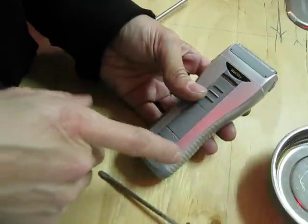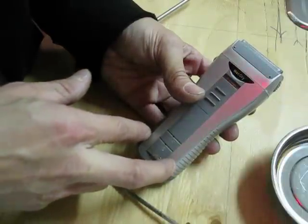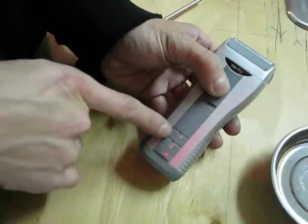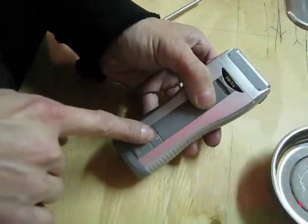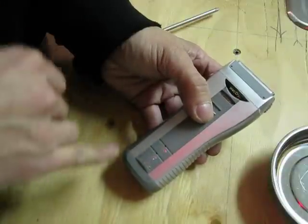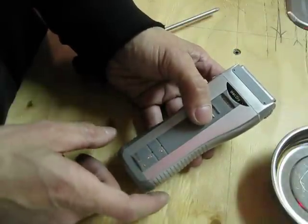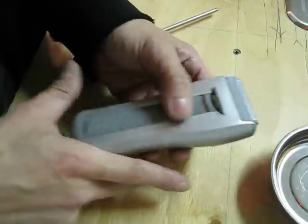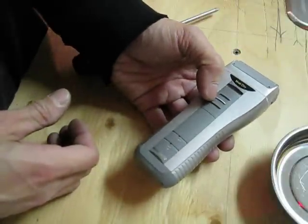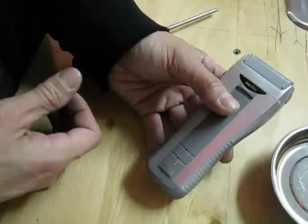The difference between using nickel metal hydride batteries versus NiCd batteries is that nickel metal hydride when fully charged — the voltage isn't as high as a NiCd, if I remember right. Now when I use this, the recharge light doesn't come on until it actually gets weak, unlike the previous battery. But since the voltage doesn't reach the full NiCd level, the charge light will actually never go green — usually when charging it's red, and when done it goes green. It doesn't go green because it never reaches that full voltage. So after using it for three or four minutes, I just plug it in overnight or after I use it in the morning, and unplug it when I get home that afternoon. By then it should be pretty much fully charged.